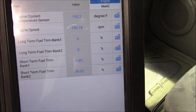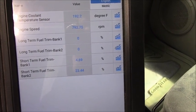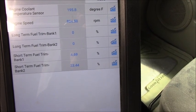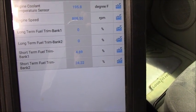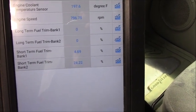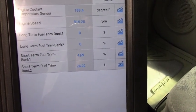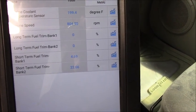Think about that, it's not only the sensor producing the signal. The sensor may produce a good signal, but inside the computer something is intermittent and doesn't accept the signal, it's stuck on high voltage, and the computer will set the high input. Or the software is jammed, and the computer will set the fault code. But if we try to change the sensor, we might be in trouble. I'd rather not do anything with this case.